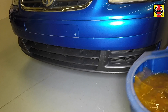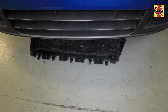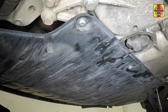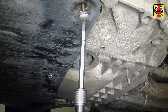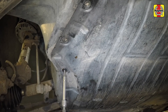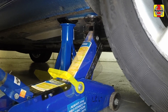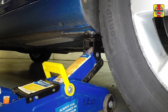Don't forget to remove the drain tray. Position the tray under the vehicle. Slide the tray forwards to engage it at the front. Fit the screws at the rear of the tray, then refit the nearside screws, followed by the offside screws. Raise the vehicle using a jack, remove the axle stands, then lower the vehicle to the ground and remove the jack.